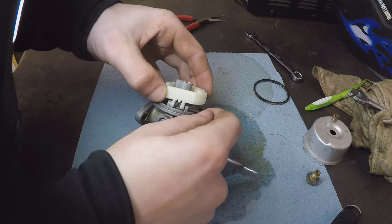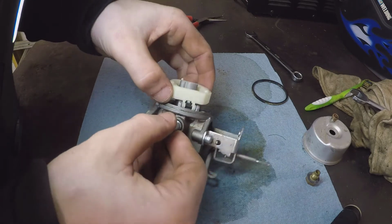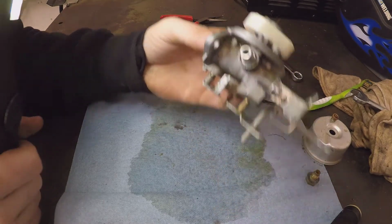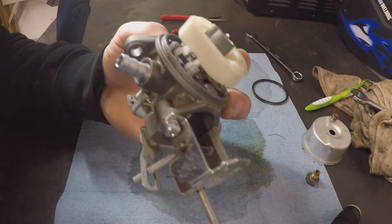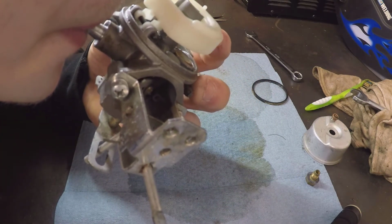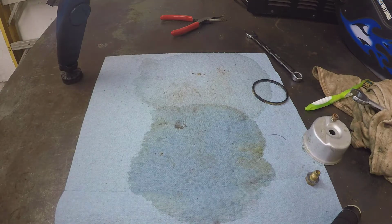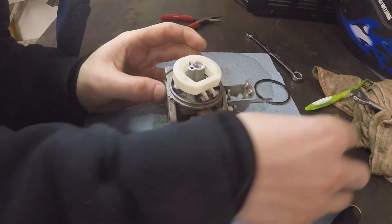This is kind of hard to do in front of the camera. Can't really see what I'm doing. There we go. And that pin's gonna slide through there. So I'm going to blow on it. I'm going to put my mouth up to that, and if you can listen. When I lift it up, you can hear the air coming through, so that's good. Hear that? So this carb is right now good, except for that gasket, so...